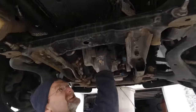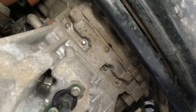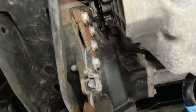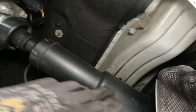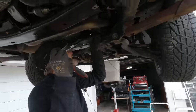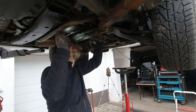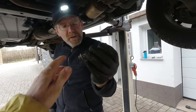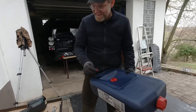Did you see how dry it is between the engine and the transmission right here? This is a 2015. The new one is completely oiled up — it has an engine failure. But this thing is completely dry — you hardly ever get one that dry. This drive shaft here is new. The previous owner had some vibration in the transmission and they sold him a new drive shaft for 900 euros — stupid idiots. Remember, getting the starter motor out on a Discovery 4 is supposedly easier than on a Discovery 3. There's not even any corrosion on this bolt and no copper grease — we're waiting for the disaster. Don't forget to open the breather hole.